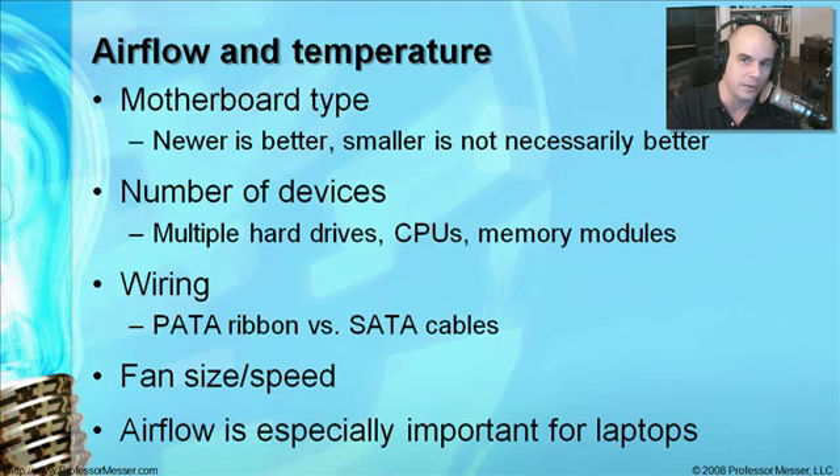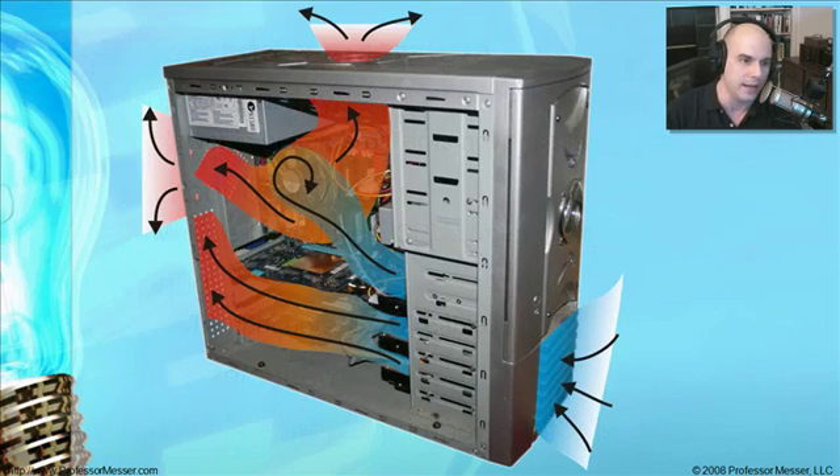Check to make sure the fans on your laptop are clear — make sure there's no dust, and if there is, get that dust out of there. It may take opening the laptop and cleaning out the dust from the inside, because there are heat sinks on the inside as well. I had one laptop that ran its fan at a very high speed all the time, and once I opened it I saw it was full of dust. Once I cleaned the dust out, the fans went down to their lowest speed and the laptop became much quieter again.